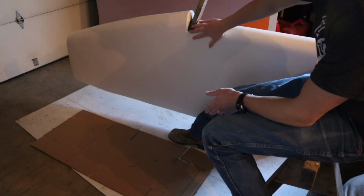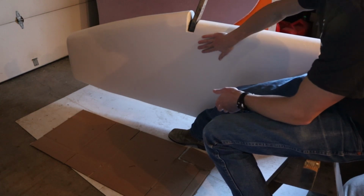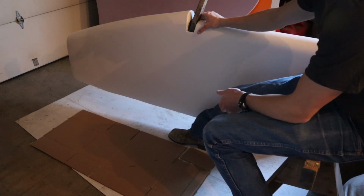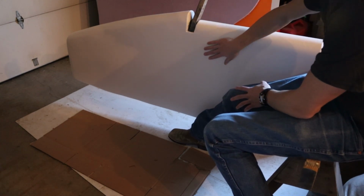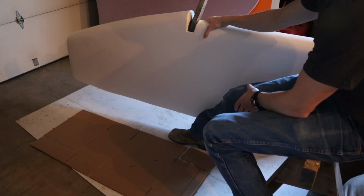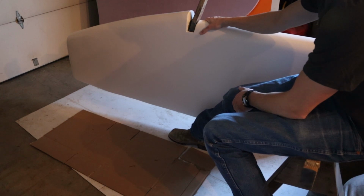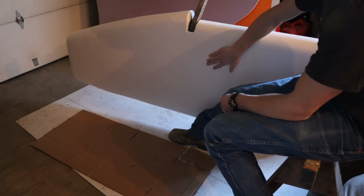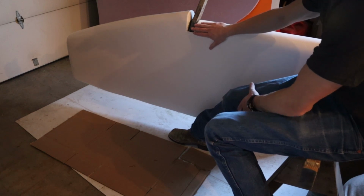I skinned the entire thing, and it's more fiberglass with epoxy resin, so it should all be waterproof. And then we painted it with two layers of Total Boat, Total Protect barrier coat epoxy. And then I put a single coating of a product from Pelagic Marine, and so it is a modified epoxy that contains silicone in it, and the silicone creates a super slippery boundary layer on the surface, which helps reduce the amount of marine growth on the rudder.